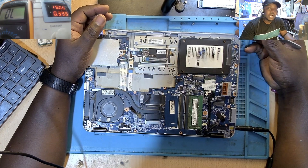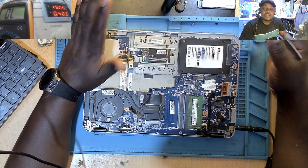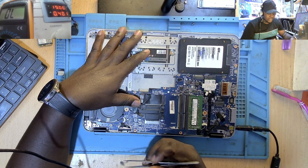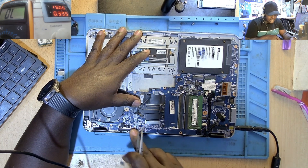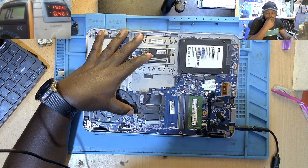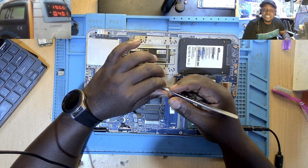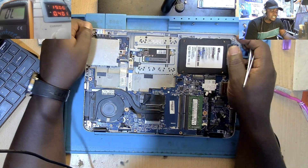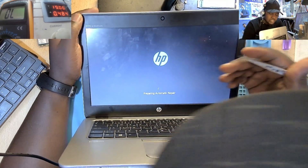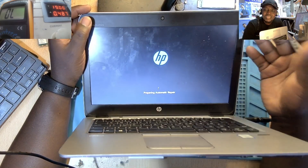This chip — in all these machines, this is always the problem. I've taken that chip and swapped it with one from a working machine and it's the same problem. When you remove the chip and check for short circuit, the short is always on the PCH side, never the other side. When I inject voltage, the PCH gets hot right at the edge. Trying to reflow the processor is very risky — the machine could go completely dead. I've tried firmware updates, BIOS reset, ME region cleaning — nothing works.